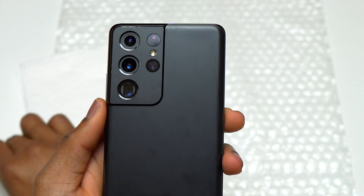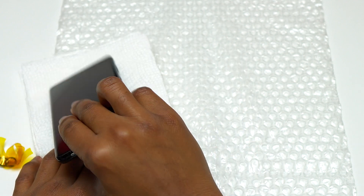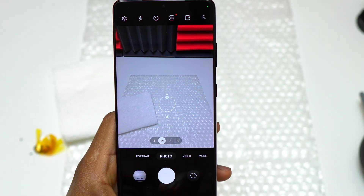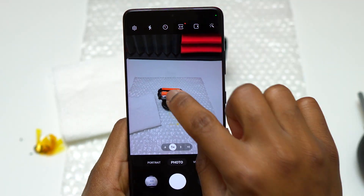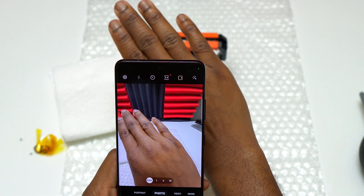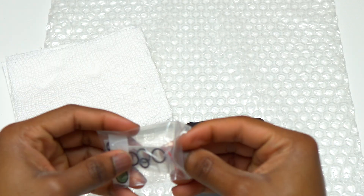If you have more camera glass broken, just follow the same process — protect the cameras that are exposed before hitting the other broken camera glass. The next step is critical: you need to test all the cameras. Make sure you test all the zooming points of your device to make sure no camera is blurry and none of them are acting up.